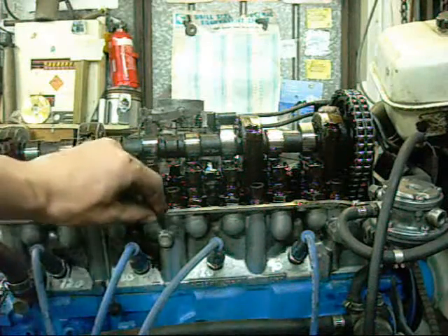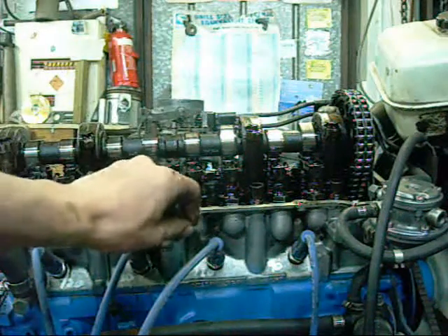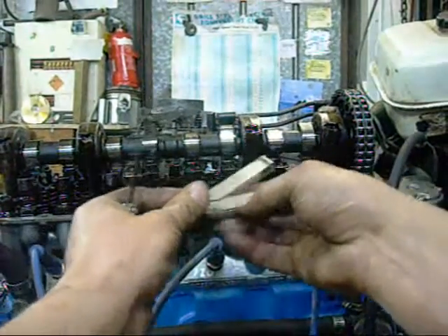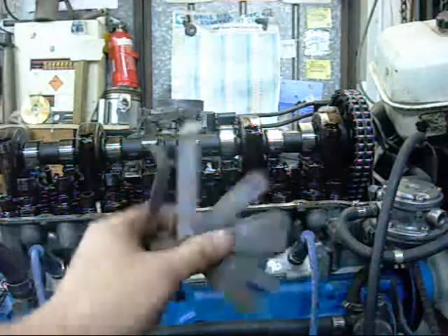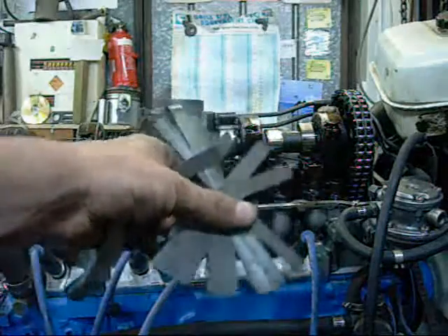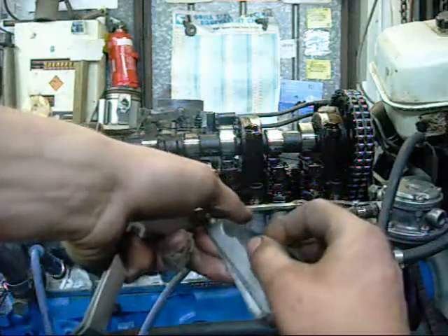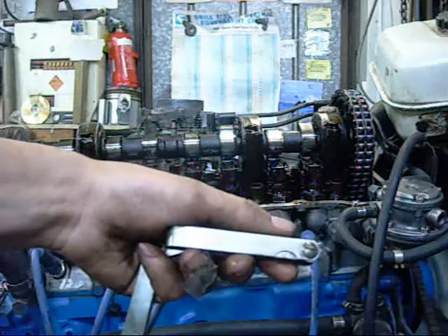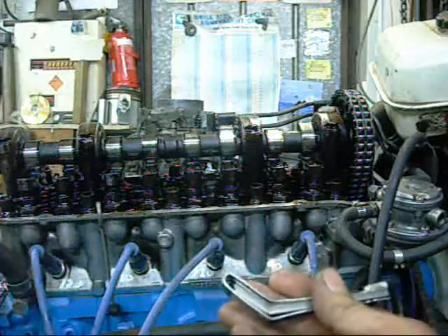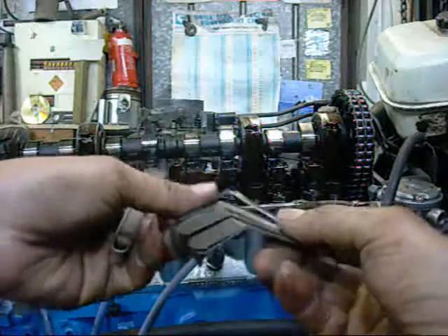Good thing about these offset gauges is if you've got a Ford or a BMW head, the cams often recess right down the guts of it and you can't get to them with normal parallel gauges. These are American-made Cortland gauges and you don't really want to be bending them and trying to jam them into a tight spot — they're a good quality gauge. My Starrett gauges are on loan to a friend and they're even better than these. These ones are old Cortland number 230. American stuff; these others are just cheapo Chinese gauges with only a few certain sizes, but they're all offset or angled.